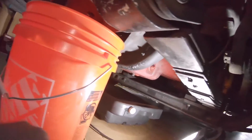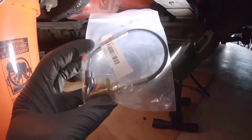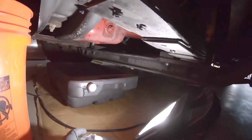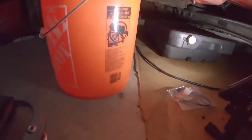This is what I'm going to use for the coolant, oil, and then we have a plus. I have this dimple magnetic drain plug I'm going to put in because we have to drain the oil anyway, and also our oil temperature sensor for our gauges that we previously installed. If you didn't see that, click on the link up top. You can see that, but this plug right here where the temperature sensor is going to live is going to go into the side right there of the block. And then the drain plug, of course, where the drain plug goes.